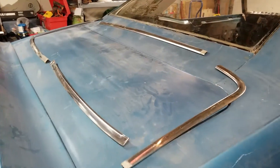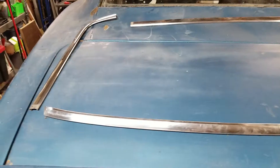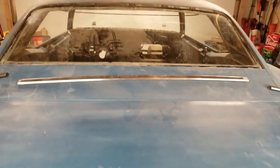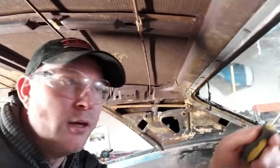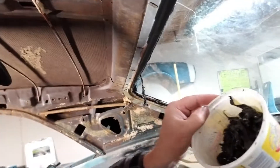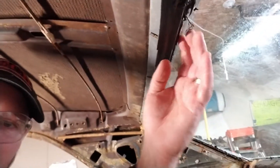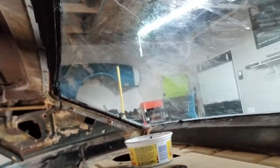The back window channel comes off the same way — just little clips all the way around. It's in five pieces and this piece here just overlaps a little bit. I'm going to go ahead and cut the back window out from the inside — that's definitely the way to go. I'm using my pick tool, which is soon to become my very favorite tool. I can get up in the area where it's attached and actually pull that goo out of there. It's pretty gooey. I've done the sides and most of the top; I tried the top from outside with the pull knife and it did okay but left a lot of goo, so I should have this thing out pretty quickly.